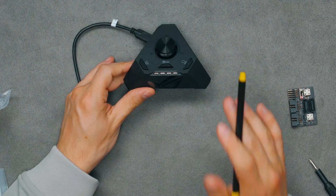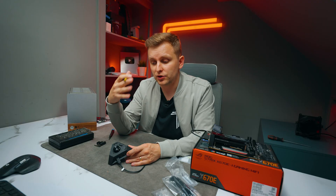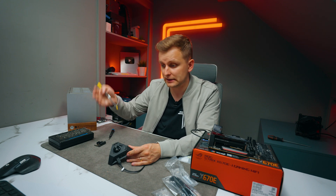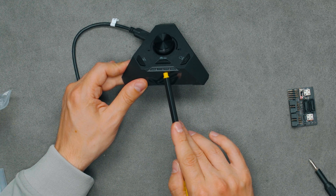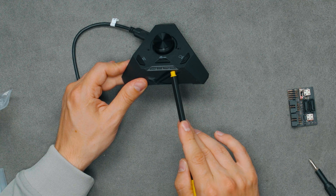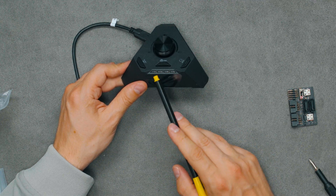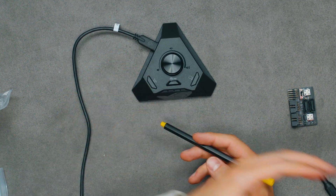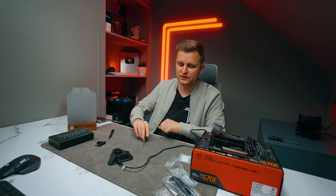The middle button switches PBO on or off — like a toggle switch — which is a very fast way to enable or disable Precision Boost Overdrive. One of my favorite features are the four LEDs on the front of the hive. If you've used ASUS motherboards before, you know there are four POST LEDs: CPU is red, RAM is orange or amber, VGA is white, and POST is green. Now I can easily see what's happening during boot without the LEDs being buried inside a case.